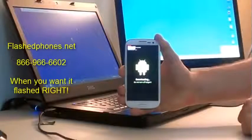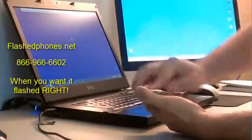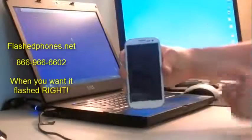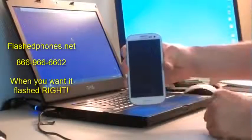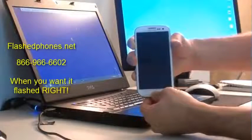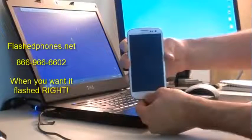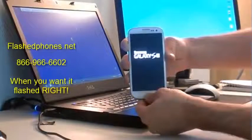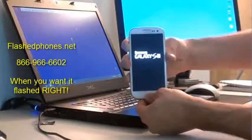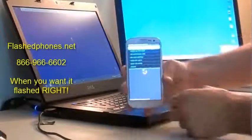We're still in downloading mode, so we want to boot into the custom recovery we just flashed. Pull the battery out of the phone again, then put the battery back in. This time we're going to hold volume up — remember last time we did volume down. Hold volume up, the home button, and the power button all at the same time. As soon as you see the Samsung logo pop up, let go of the power button but continue to hold volume up and the home button. It'll boot us into the custom recovery.